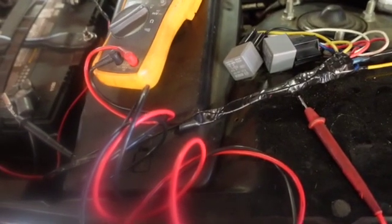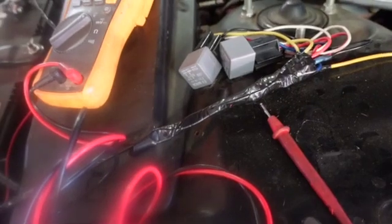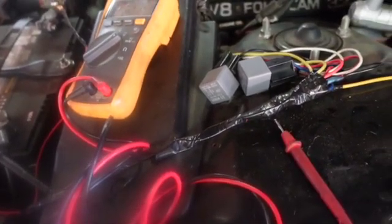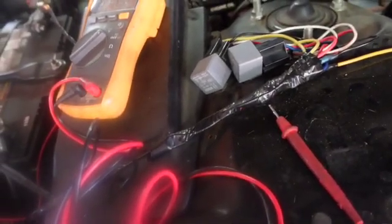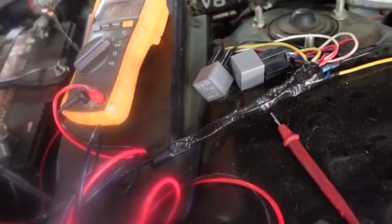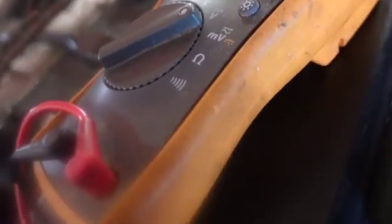So it could be. Turn the switch off to the car. Yeah, turn the switch off to the car. Yeah. So. Try the fan again. Okay, well it worked. So your parasitic draw could have been through a bad relay. So that switch having constant power should not drain the battery, right? There's all kinds of constant power, even in the TR4. There's all kinds of things with constant power. If you were wondering, they're brown wires. Let's see.